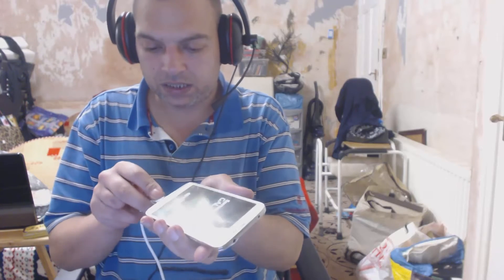Let me just plug this back in. That is going to be the first bit. Please — this is going to wipe everything, don't say to me 'oh god you have wiped my phone.' Start the phone up again. I am not going to be able to show you this because mine is not wiped. Start the phone up, go through the setup, sign in to your WiFi because you will get the WiFi screen, skip the terms and conditions. Google will check something — it will say checking — and then it will come up asking for your Google email, and this is where you are stuck.